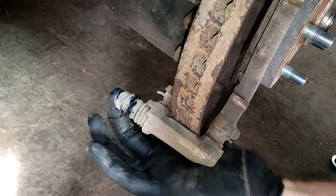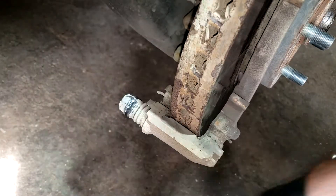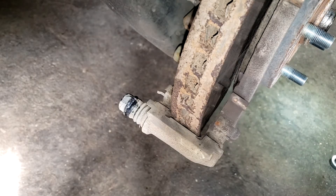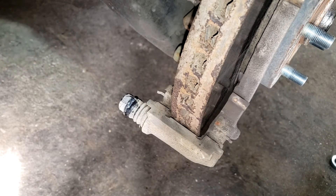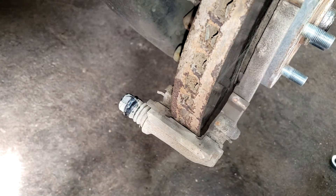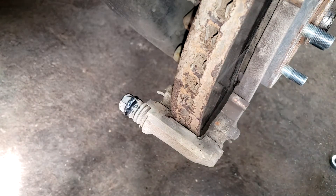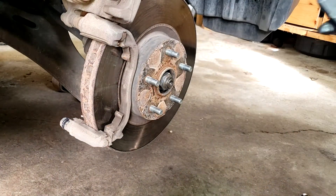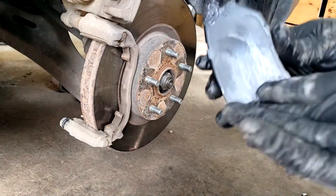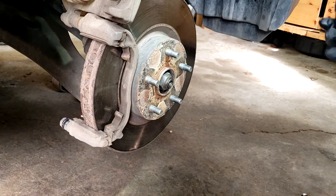To do both the way I have the caliper on — you can see I just pushed it back on there. I'd go ahead and bolt the caliper up and then do the top one, and pull it down away from it that way. Go ahead and grease that slide pin — don't forget that. Grease the pads for the brake. You can see where I grease there — I can smear some there if you have extra. They make this brake quiet stuff that's basically just grease.